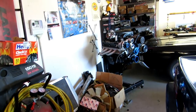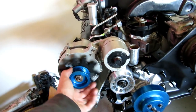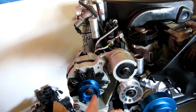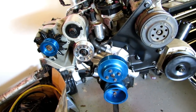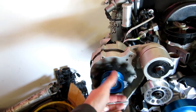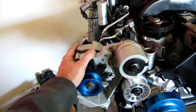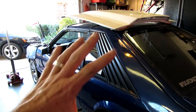The motor is really ready to go in, but the belt is going to be too short. I'm probably going to try to do a 3G alternator upgrade before putting it in, and keep the underdrive pulley to see how the 3G will run with it — if not, I'll just swap to the stock pulley, which is smaller. These pulleys are much tinier than average. The current setup is not going to cut it — it'll cause too much strain on the alternator and it won't be spinning fast enough to keep it cool, which is what causes fires. So I need to put a 3G on before we fire up the motor. There's a lot of changes — everything from the fuel pump to the mass air conversion to the new engine.